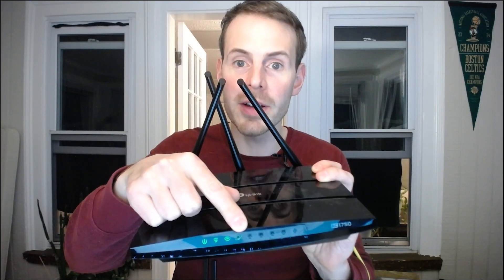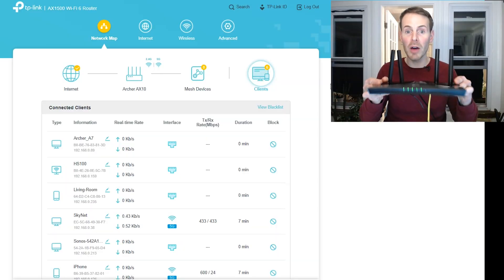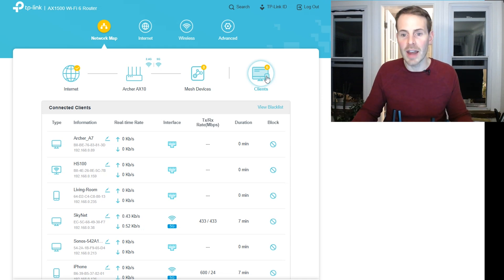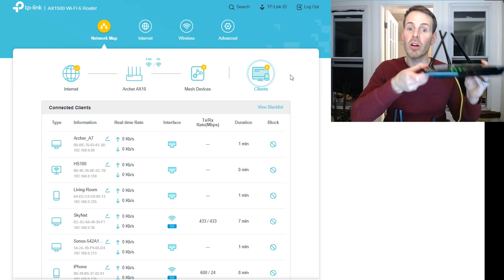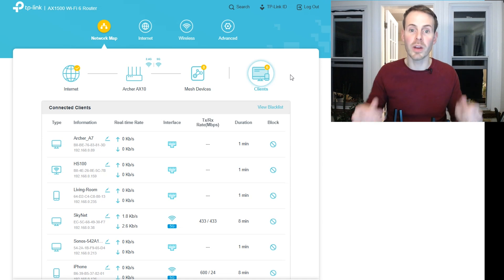Now that that's done, we can power on the old router and see what everything looks like. Now that our wireless access point has booted up, you might notice a little change — that old network light that was previously orange once it rebooted in access point mode is now green, and that's because it's receiving a connection to the internet from the primary router. So this is a good sign. The other thing I want you to take note of is the number of clients connected to our new router. It was previously showing two devices, and now it shows six devices, because there are four devices connected to our new wireless access point. This shows us that our access point is working properly, and our new router is functioning properly as well.